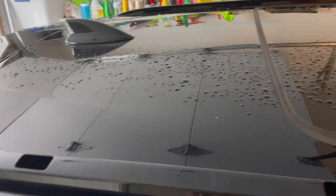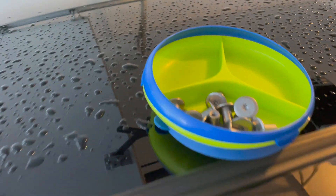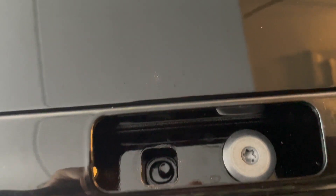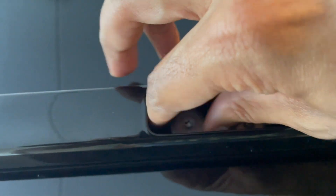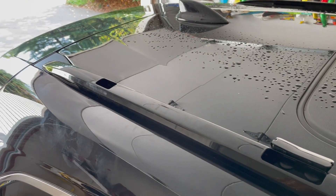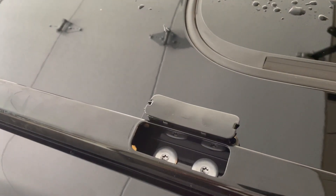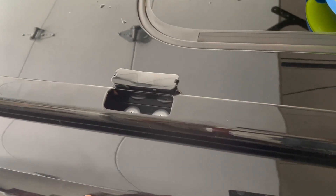The holes are going to be on the inside right here and the other one on the other side. You can see these are the bolts. I'm using this one because it doesn't slip — just a quick trick. It's going to go like this, just make sure it's aligned. Don't go too tight right now, just make sure everything is loose. So go ahead and put the nuts in. Once you've done that, use either a torque wrench as suggested by the manual — nine pound-feet of torque — or just tighten until you feel comfortable with that.